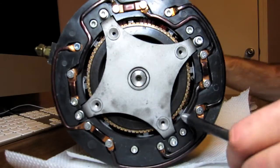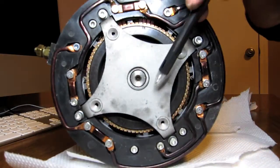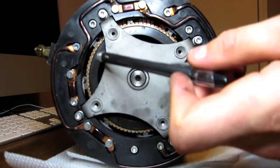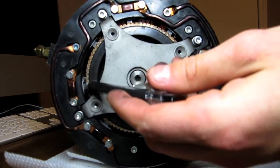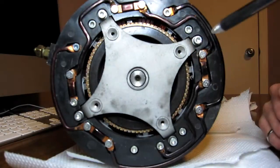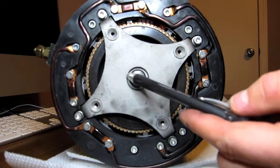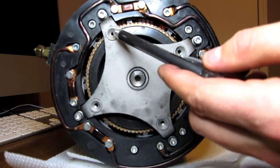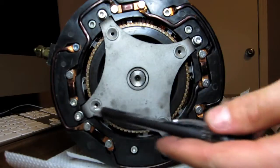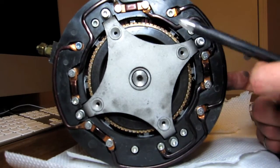So this is the motor, and as you can see there's actually eight sets of brushes — one, two, three, four, five, six, seven, eight. Each brush is actually two individual brushes, so there's a total of 16 brushes acting as eight. This design is really nice — there's a big metal plate in the middle that supports the bearing for the shaft, and then they have these molded bus bars in here. It's molded into the plastic so it can't go anywhere — they've done a fantastic job.